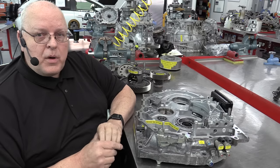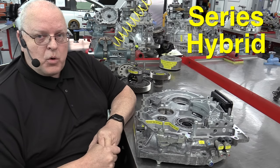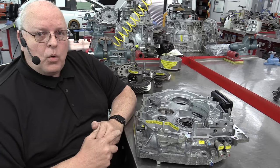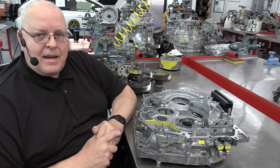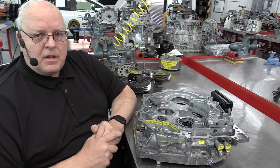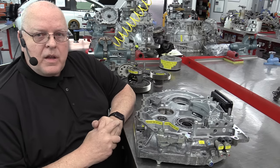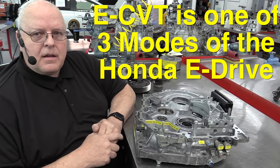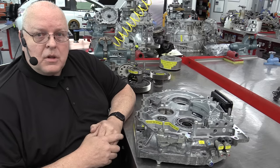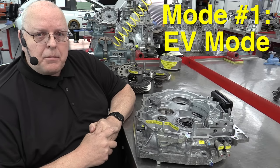This transaxle has three different primary modes of operation, and I'm going to show you all three. One of those modes is a series hybrid mode — yes, a series hybrid mode. That is different than what Honda has used for many years: the old integrated motor assist or IMA system that came out in the late 1990s and was used through 2016 in the last version of the Insight. So this is the new eDrive system, which in sales literature they call an eCVT — an electronic continuously variable transmission. But that's only one of the three modes. So let's look at the first mode: EV mode, electric vehicle mode, where it can run on electric power only.